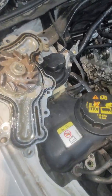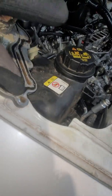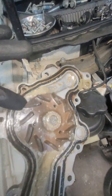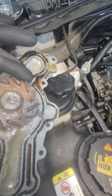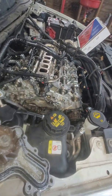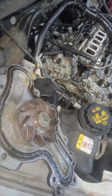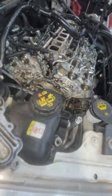This gasket goes flat like that and it starts throwing antifreeze inside the engine, and it mixes with the oil. So if you're just doing an oil change, you start the car and then open the oil cap, you will see that tan color all over the inside of the engine, and people will assume it's a head gasket.